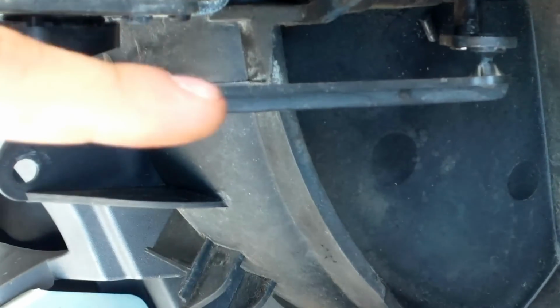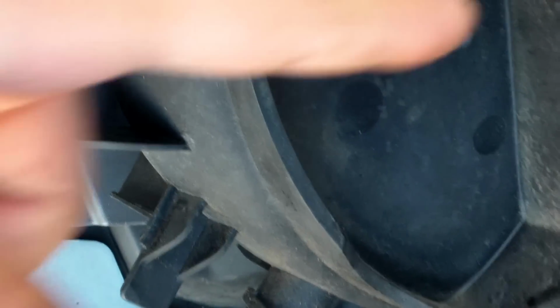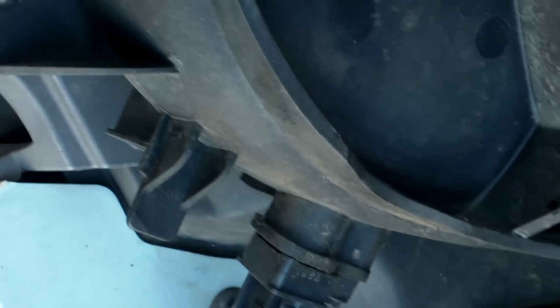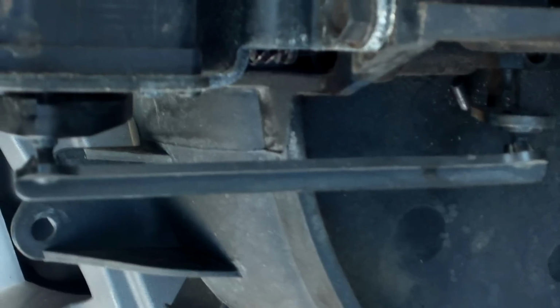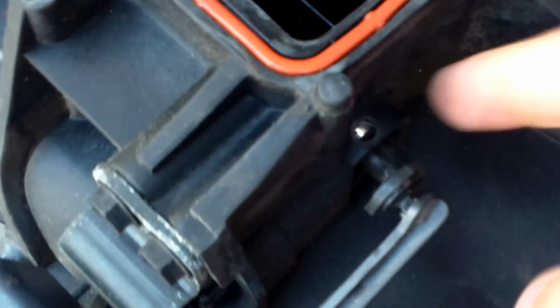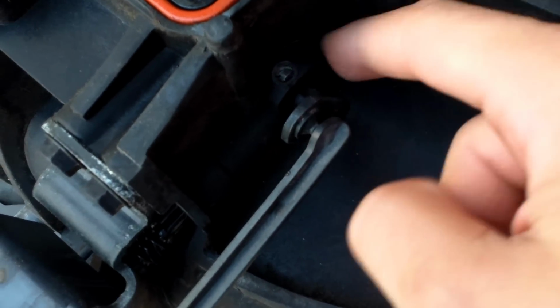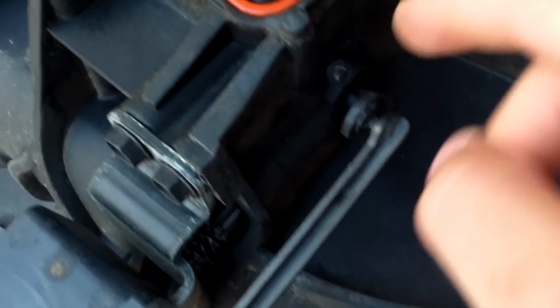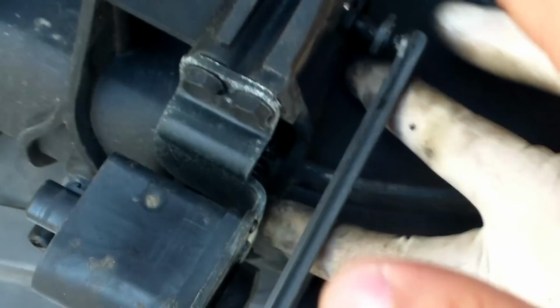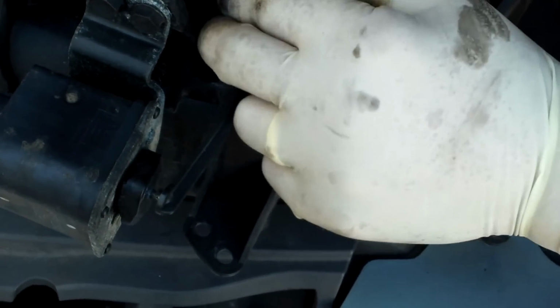Now you can tell how that rod is aligned. Instead of before, it would go inward right here, because that moved in, but now it's fully aligned. And if you understand how this works, now since the longer rod was pulled back, now it works close enough to the bearing that's in there, and it should seal, and you should have no air leak. And this whole thing is sold in one piece. So the issue is that at the dealer you can't get anything separate, and that's why the repair comes out so pricey.